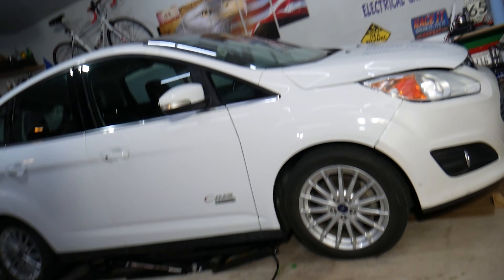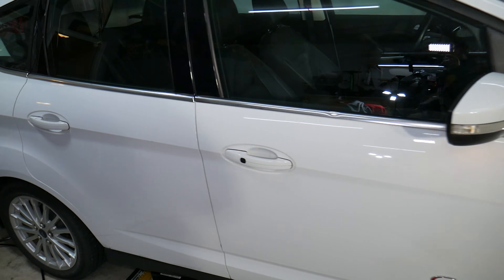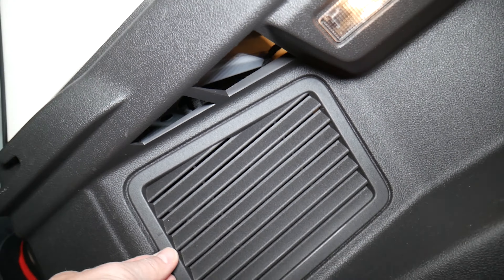Let's go ahead and explain how to remove the rear tail light so we can get to the rear turn signal light bulb. Come over to this side — I think it will be easier so you can see it better. We're going to open that cap, just pull it right here. We have a trim piece here so we'll pull it out of the way. You can see you have these two plastic fasteners that you need to unscrew — that's what's holding your tail light in place.